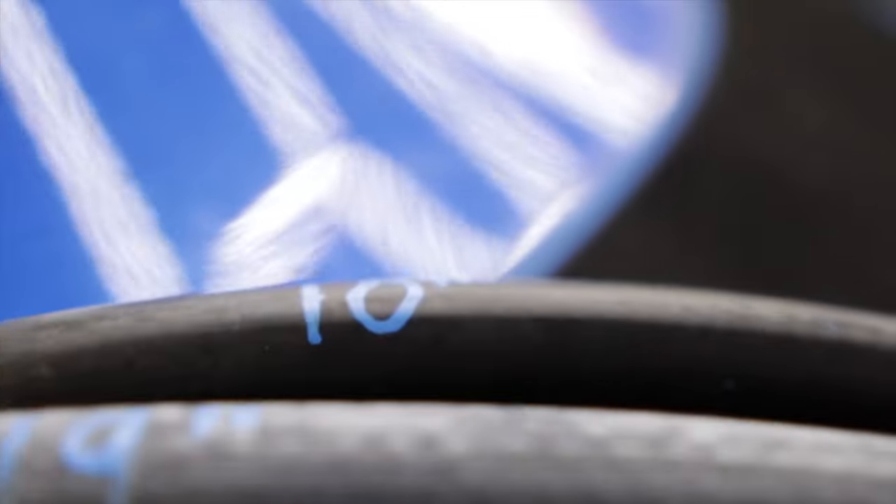Now that all that's done, we can get to the fun part and start installing the new water lines. A little tip I like to use: go through the instructions, find all the lengths of hose you have to cut from the supplied hose the kit includes, cut them all ahead of time, and write the lengths down on the hose. It'll make the install much easier, and being that the hoses are labeled, you already know which one goes where. Keep in mind that the lengths specified in the instruction manual are rough cuts — you may have to trim them a little bit to make sure there are no kinks in the water line. The reason these are rough cuts on the longer side is because you can always cut more hose off if necessary, but you can never add hose once it's already cut.